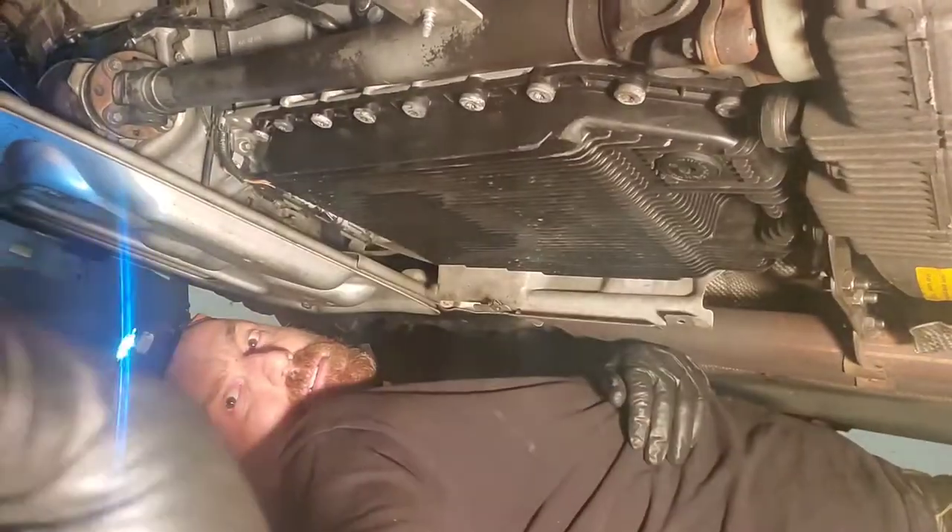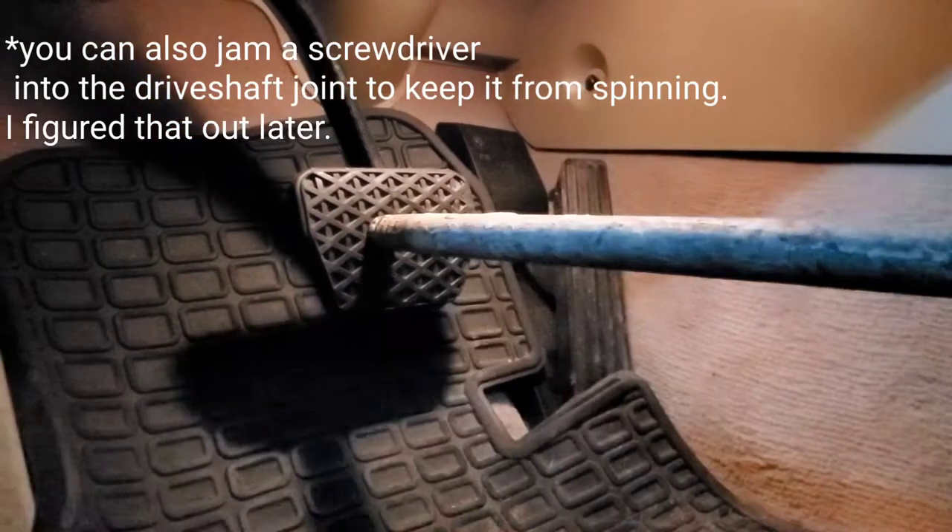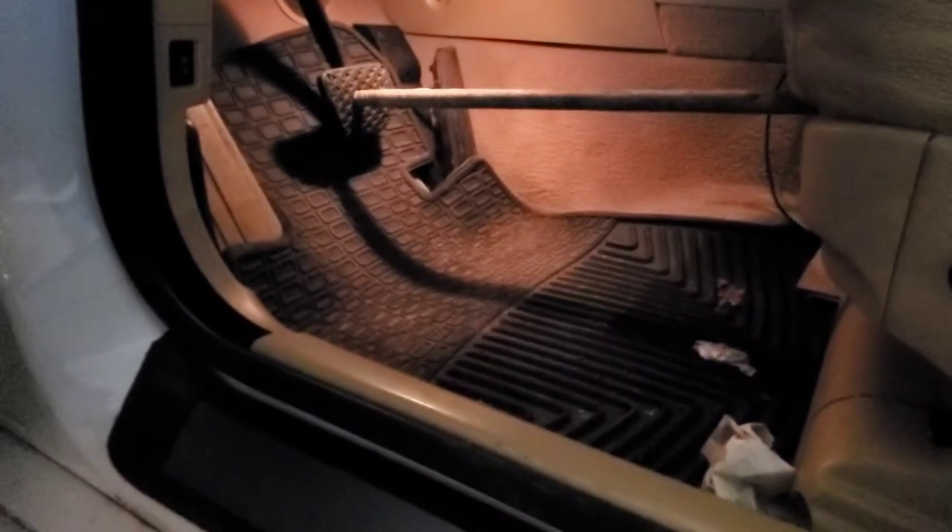So we've got to remove — or lower — the drive shaft. This only applies if you have an X-drive car with the drive shaft going to the front wheels. This being a wagon in North America, they're all X-drive I believe. Now the problem is once I start trying to remove that drive shaft it's just going to spin. So what I'm going to have to do — you can get a friend, if you had a friend, I don't — to press on the brake pedal. If you're like me and you're a sad lonely loser, what you do is you take a stick and move the seat forward.